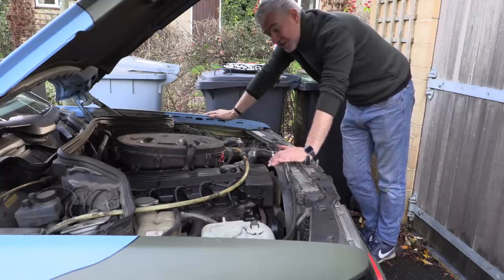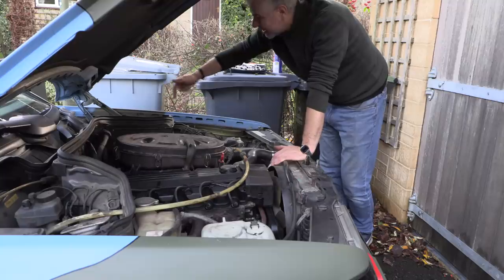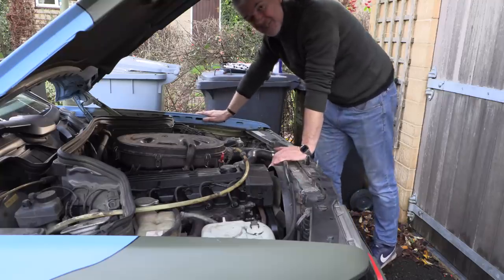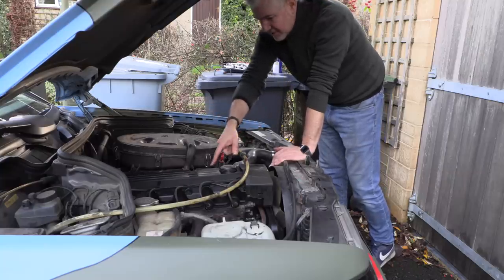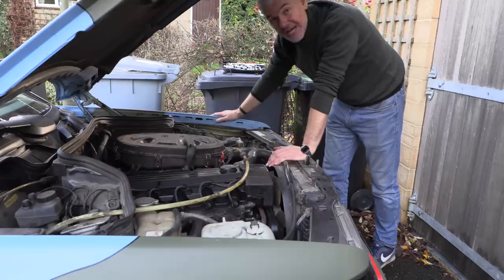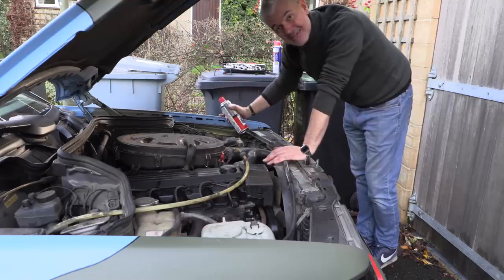There are various ways to check for vacuum leaks. Probably the best way is to have a little smoke machine, plug it in after the brake servo, and you can see where the smoke comes through and where it's leaking. Another way is to use a propane gas torch — don't light it — but while it's running go close to all the unions on the vacuum and if it starts running badly you know it's sucking air through that union. Another way is to spray carb cleaner, and because it's flammable it will make it run rich.